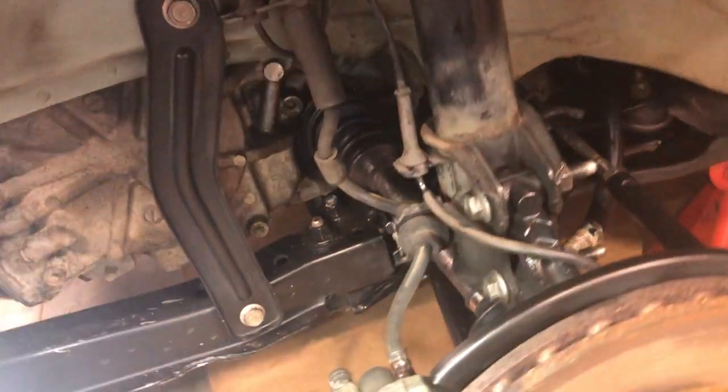Below that, where you see the little striped piece, that is the sway bar. Those things are very hard and hard to bend — I don't know of anybody who's really bent one unless it's in a bad crash. Right there is a little torque control rod and it goes up and fastens to the strut assembly. That's what allows the suspension to move up and down and control its oscillation.